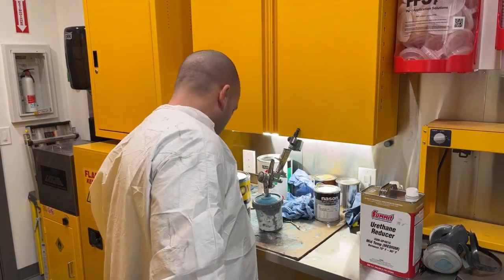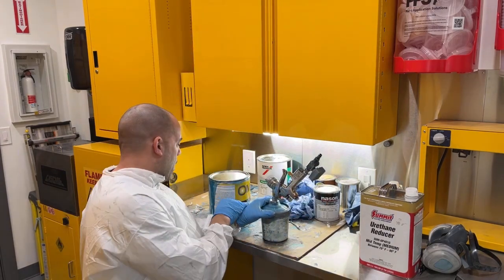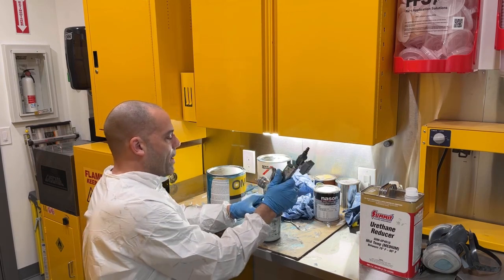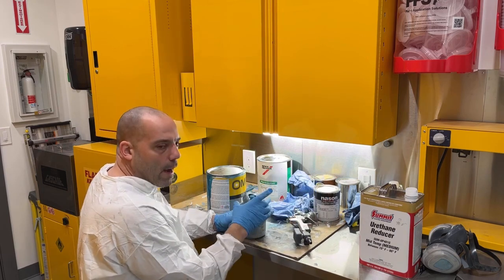Of the wrong color. My spray pattern's turned in some because this color does not want to cover really well. So I tightened up my spray pattern a little bit and I under-reduced the paint. So it's coming out all right.